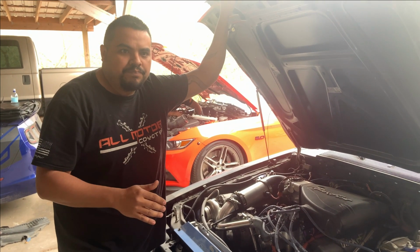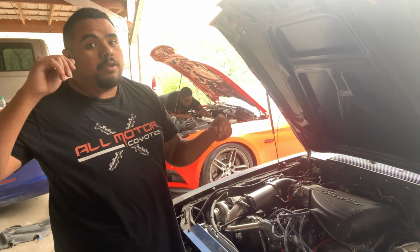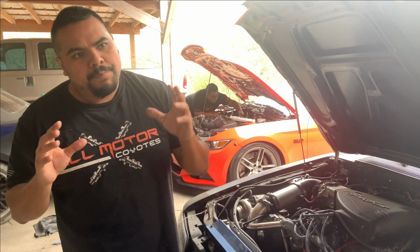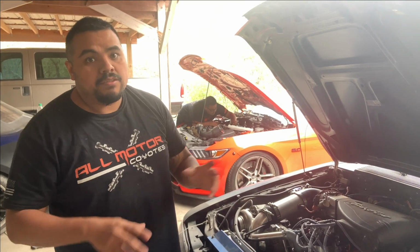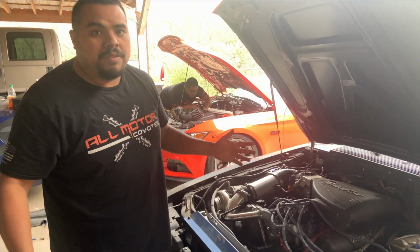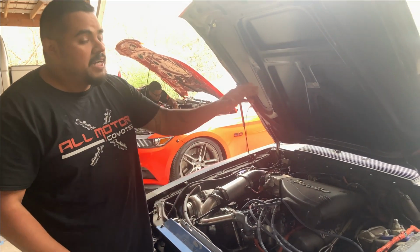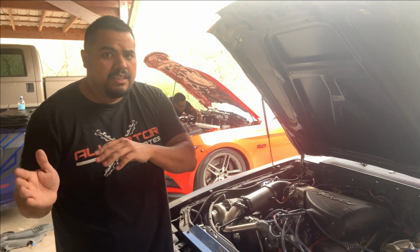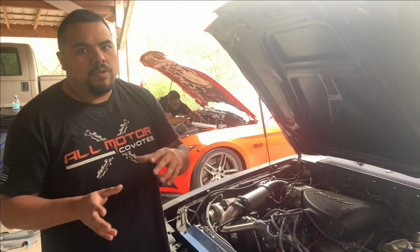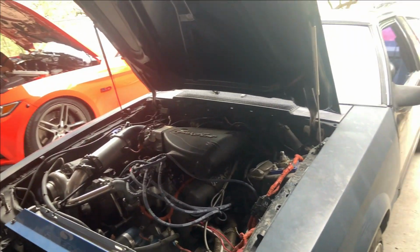On the newer cars, it might take 3 or 4 tries, but eventually it'll fire up. Then it'll start making its adjustments on its own, and you'll get perfect fueling, but you'll see that your fuel trims are way out of whack. So then that's when you can make adjustments. On these other cars, it either works or it doesn't. Yeah. There's no in between. Yeah. So that's how we start making these adjustments based off of the wideband. It's very, very important on cars from 2010 and below to get a wideband so that we can go ahead and see what your fueling is 100%. Yeah. And that's it. That's true. Something to keep in mind.